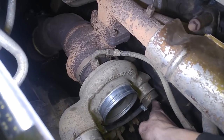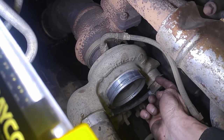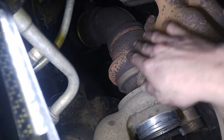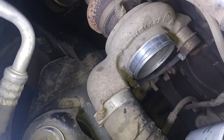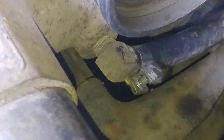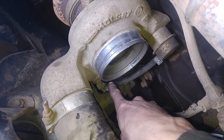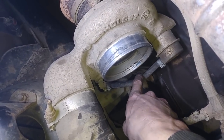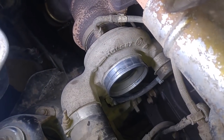Now we got this thing out of the way. You can see — this is the wastegate right here. This is like a rubber diaphragm in the middle here, and then as it sees boost from this line, it pushes this way against a spring, and then there's an arm down there that goes to — it's on the back — there's a valve back there that just bypasses the exhaust around past the turbine and out. There's a little elbow right here. If I pull it out and just modify it a little bit, then we can change the amount of boost pressure that goes through this line and what the wastegate sees. And then we can allow it to open at maybe 40 pounds instead of 30, which allows you to put more fuel in.